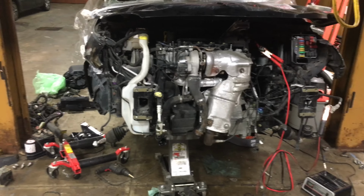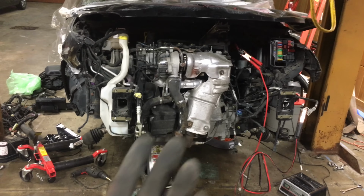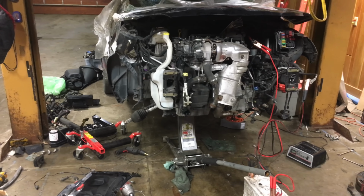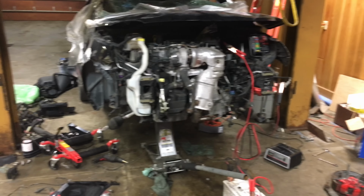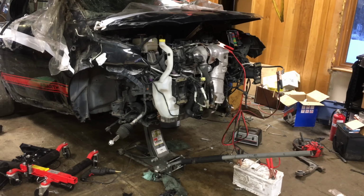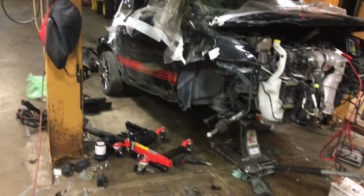I've pretty much given up trying to restart this thing in the car. I know it ran, so I guess that's at least a good thing. The check engine light doesn't show up when you turn the key to accessory, which it should. So I'm just going to attribute it to the immobilizer, and then hopefully I can figure it out at a later date. If not, I suppose I can always sell the engine and get another one some other day. Wow, this car is totally ruined.